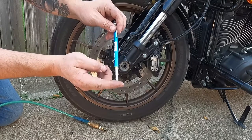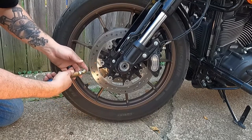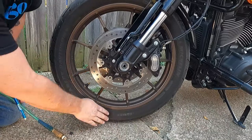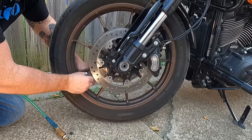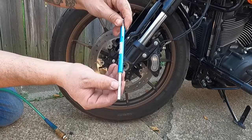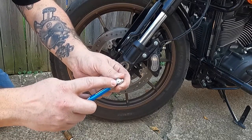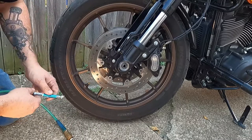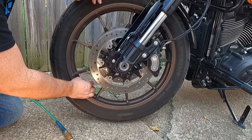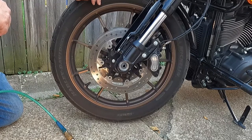That took us up to about 32 PSI. It's not a huge tire so it didn't take very long. If you have a little air compressor that plugs into your cigarette lighter, it may take a little longer. After a couple more shots, we're at 35 PSI — we'll call that good; one PSI won't matter. Also note: looking at the sidewall is not a good judge of tire pressure. If you accidentally overfill, you can use the gauge cap to push the little tab on the valve stem and drain some air back out. Put the valve stem cap back on finger tight. Now we're going to check the back one and we're ready to go ride.